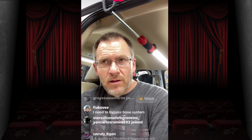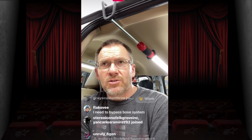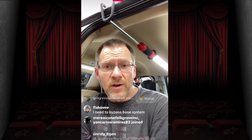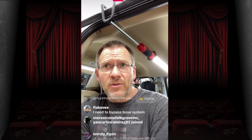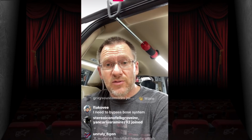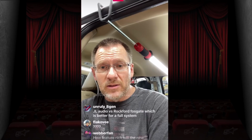Metra makes a ton of Bose harnesses or amplifier GM harnesses. Just Google GM amplifier bypass harness, and it should take you to a page that Access or Metra has, where there are tons of harnesses for bypassing GM amplifiers. What I would recommend doing is taking a picture of your amplifier harness first and then matching up accordingly, because there are several different ones. You may find one that matches as far as the plug, but the pin configuration might be off, which is fine because you can always figure it out by repinning the harness.